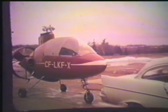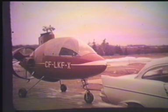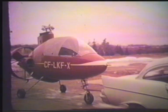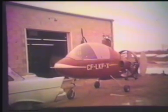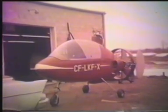That first aircraft with the tab-controlled rotors, there was just too much drag. We couldn't spin it up properly. We couldn't track the blades properly. So we went to a regular control system. Fortunately, the control system had been designed on pilot force anyway, so many pounds of the stick. So it was very, very easy to replace the tab controls with regular controls at the root of the blade. And as soon as we did that, we had good spin up, we had good tracking, no problems.